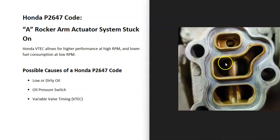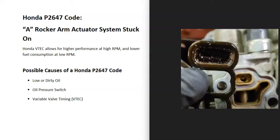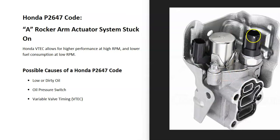The next thing on the list is the VTEC unit itself. These have ports where engine oil flows through, and there's a small screen inside. When the engine oil is dirty, or with age and high mileage, that little screen can get clogged up, preventing oil from flowing through properly and throwing this code. The whole VTEC system can also be replaced.